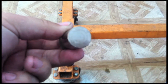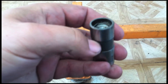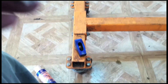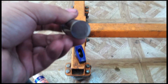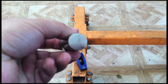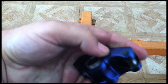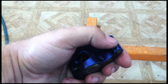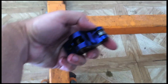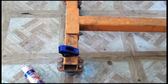A roller camshaft means that the lifters that go on top of it - these are a flat tappet, this part is flat. These are hydraulic lifters, which means there is a little spring in here; this fills up with oil making it a hydraulic unit. A solid lifter would be basically a solid piece with no give to it. A roller cam and roller lifters - this part right here, instead of being flat, would actually have little rollers on it, like these rockers do. These are a full roller rocker with bearings in them, roller bearings here, roller tips on the ends, and a roller cam would have this little roller part at the bottom of the lifter. But this is not a roller, so we don't need to worry about that.